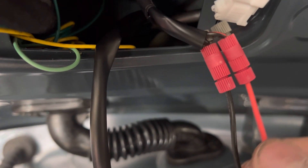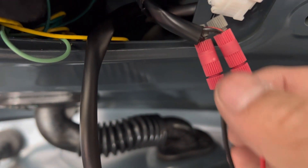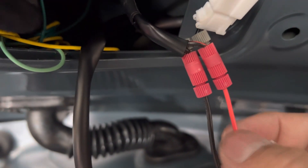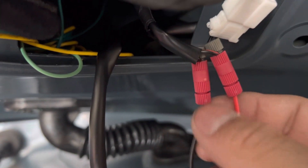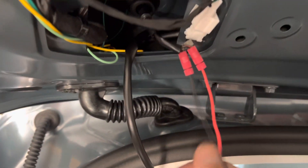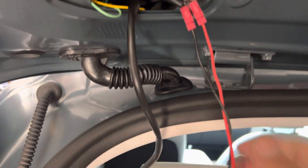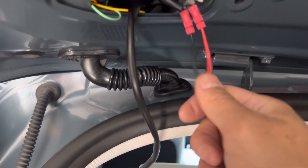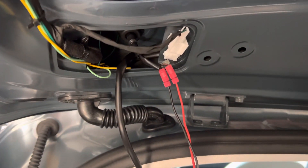So this is really the white line — it's the white line and this is the black. Don't look at the red color; this is the white line from your emblem. It goes and connects to the red and black — that's 12 volt and then the black is your ground — and that will initiate the brake light connection. We'll send you some extra wires, so again ignore the fact this is red; this is actually a white wire from your emblem and that's how you will tap into the brake.